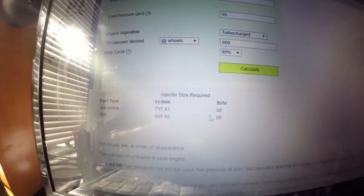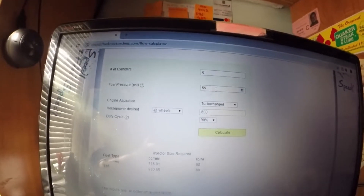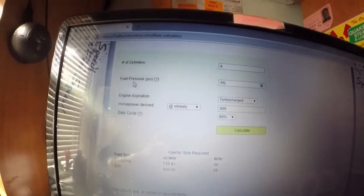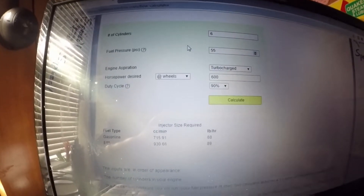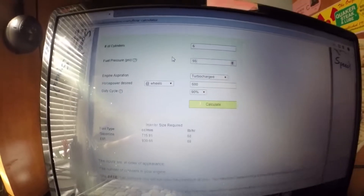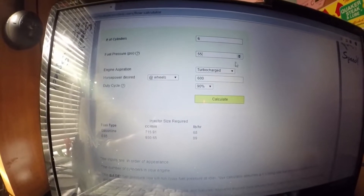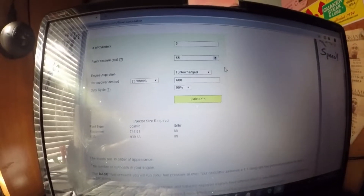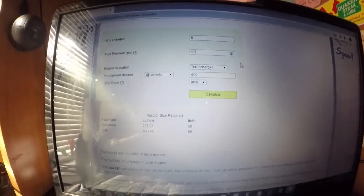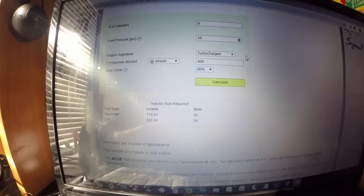What this is telling me is that I am at the fuel pump limit. I could see that, because it is a stock fuel pump. All I simply did was raise the fuel pressure to offset the added boost going into the car. So for 8 psi boost - if stock pressure is 50 or 51.5 psi for the J-series on the seventh-gen Accord - you'd bump that by 5, so it would be 56 or 57.5. Technically it should even out the fuel pressure per boost, and it's been working great until I run out of duty.